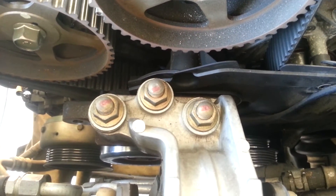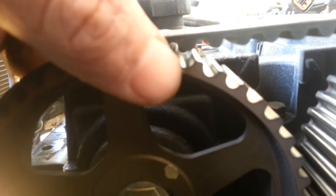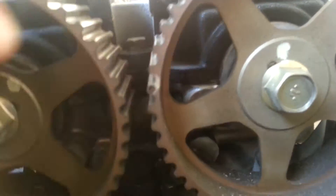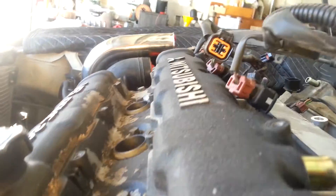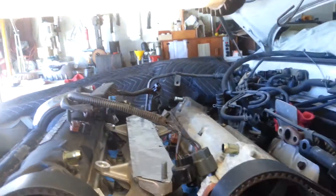In order to do so, I'm going to line up the marks on the crank first. If you notice right here, there's one dot right there, and then the other dot is right here — so this isn't lined up. And if you look inside there, you'll see two arrows. See those arrows in the back? Those will need to line up with the gears before we tear this apart. So you do this on the front and the back — that was easier to see. But we've got to do the motor mount.